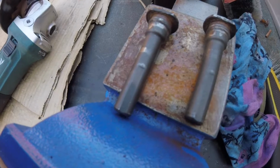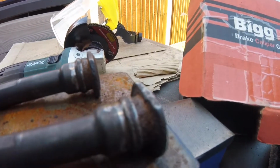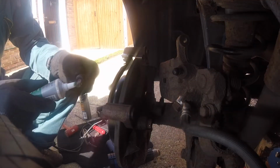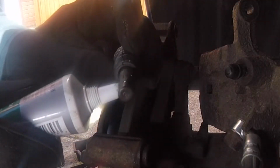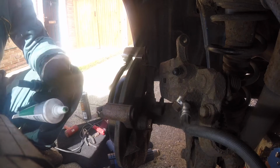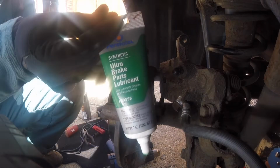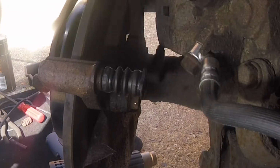The pins sold by Big Red are zinc plated and the threads aren't tapped properly. I didn't want to spend another £15 on a fine tap. They are on the Ignis too, but will go in the bin as soon as possible. Zinc on steel is not a good sliding surface compared to chemi black, smooth type plating processes.